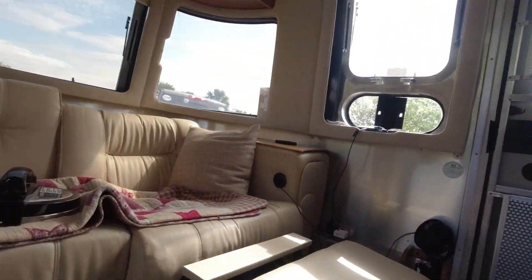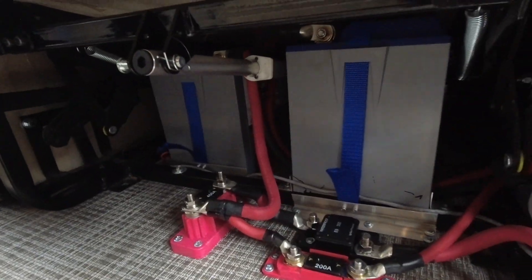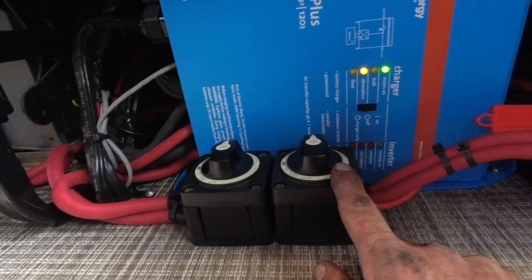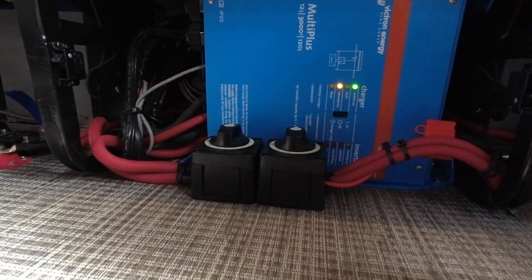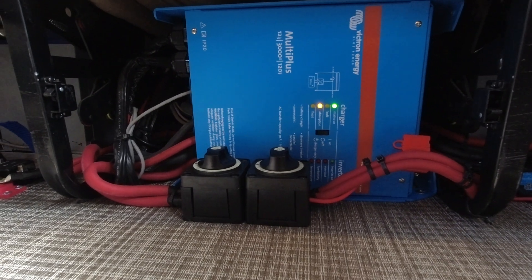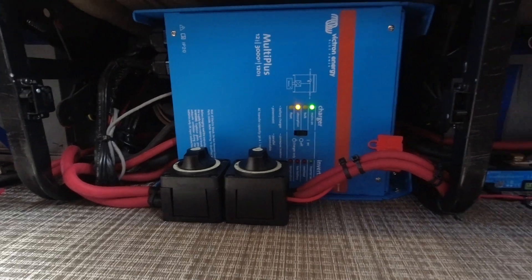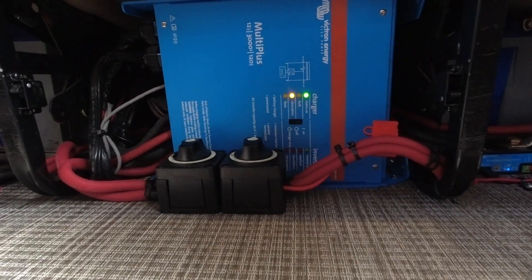Now we move to under the couch and we have two batteries on the left side, very well snugged in there. All of the wiring is completely free of touching any of the mechanism. MultiPlus, shutoff for the MultiPlus, shutoff for the RV, shunt, two more batteries. If they need to access any of the factory 12-volt stuff, you take these four screws out, this swings this way, this swings this way. Take the screws out of the MultiPlus, slide it this way, and then you have access to everything that's mounted behind it. I did it that way so we weren't blocking anything. If he has any issues with the motors and mechanisms, all the front mechanisms are accessible. You take out the right battery on each side, then you have the ability to get to the motors.